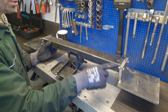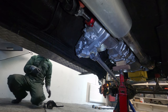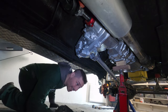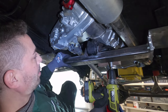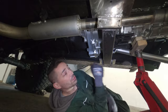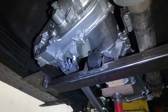From the last video, I cut this mounting section off and mounted it in a piece of box, with pieces on the side. This piece of box section just bolts on to these end pieces, and these are going to be welded to the frame stiffeners. If I want to drop the cross member, I can take the eight M8 bolts out and just drop it down. It's really just the basis of the beginning — the real work's yet to begin.